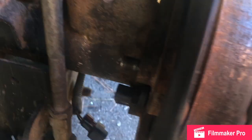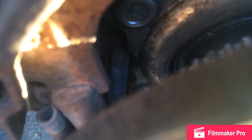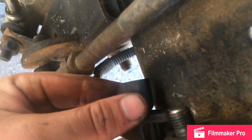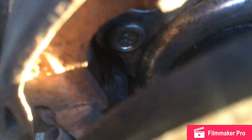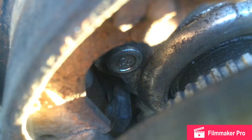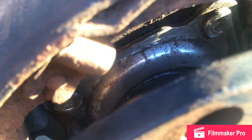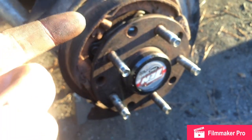All right, the four backing plate bolts are out. Now we're going to take the sensor out — pull it out. You can see in there where it has the air gap for the tone rings. We're just going to pull it out making sure it's not hitting anything; it almost doesn't even have to come all the way out — just until you can see that it's clear in there. In person you'll be able to see if it clears the silver retainer plate. Now that everything's off and the sensor's out, we are going to pull the axle shaft out.